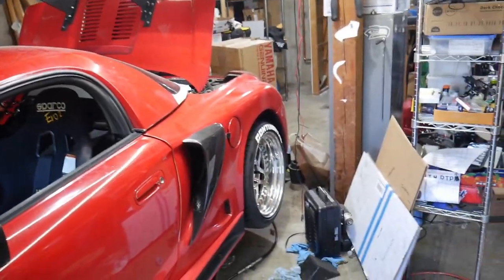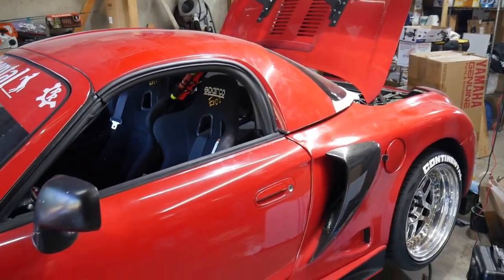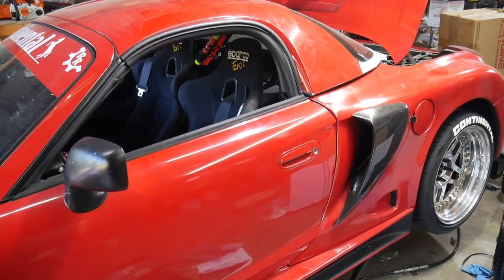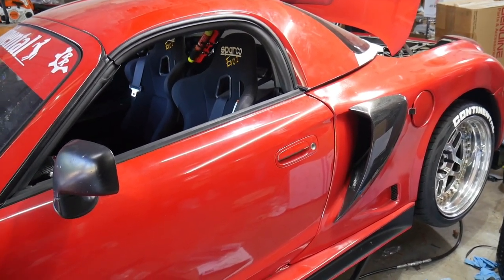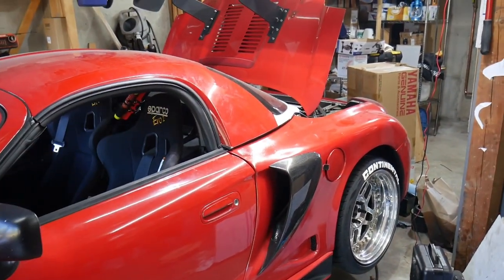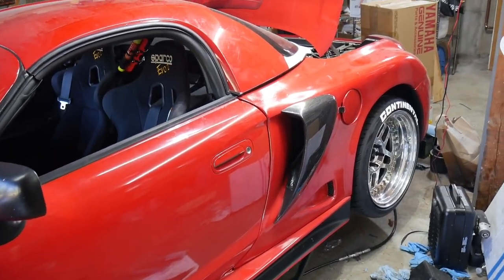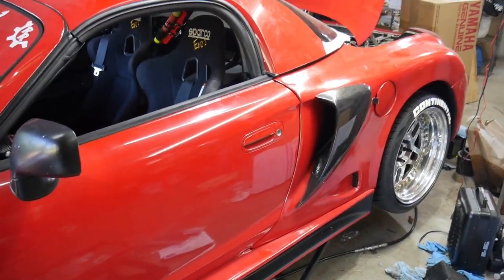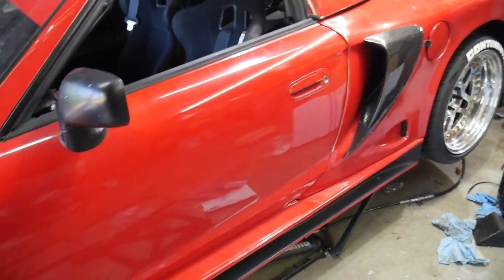As you can see, it was misfiring pretty bad. I went through pretty much everything. Thank you guys all so much for the feedback that you gave me on the last post about why it may be misfiring and helping me try to get the issue resolved. I did data log it and send it over to my previous tuner that tuned this car so he can see what the issue may be. And while he's doing that, I'm going to go ahead and take off the VTEC solenoid on my off time here and see if that's the issue as to why it's misfiring, or if it's gunked up or not. That's a pretty common issue on K-series engines, or Honda engines in general, with the VTEC solenoids.